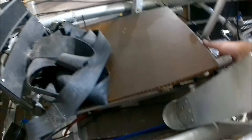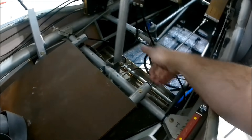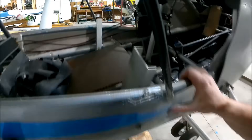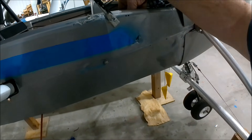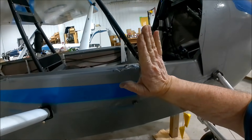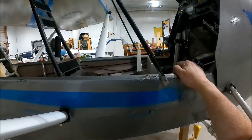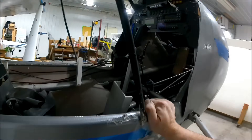The unlock for the landing gear is here. You have to move your leg over to the side and pull it out or push it in — same on the other side. I like that better than the normal setup. Normally this cable — I've seen people just poke a hole, and it sits up here going up and down. But I've got the third door, so this is going to be opening, and that cable would stick right in the way of me getting in. So I rerouted it underneath so it's being pulled forward. Much preferable.